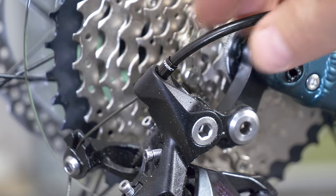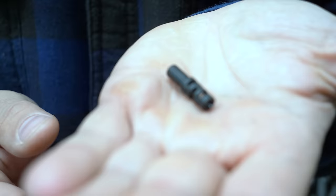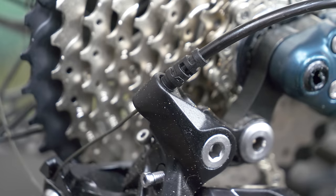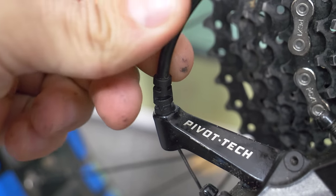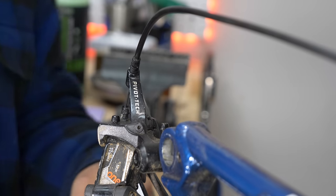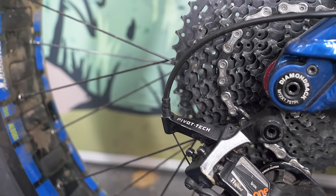At the end of your shift cable housing is an end cap, and these can actually be upgraded with anti-kink end caps from Jagwire. Just like the extension cord on a vacuum cleaner, they provide support a little ways up the housing to prevent kinks. As long as you know how to adjust your derailleur, these are pretty easy to install, and they add a bit of longevity to an otherwise vulnerable part.